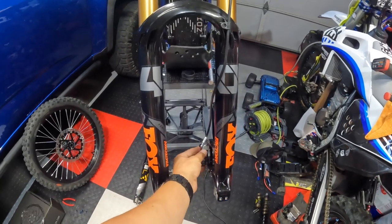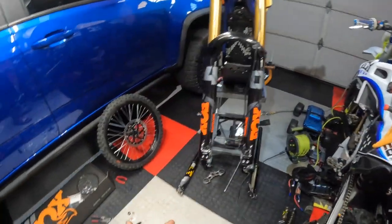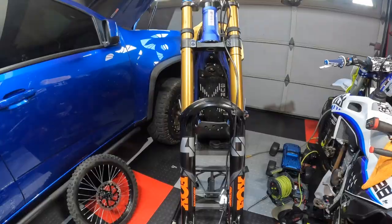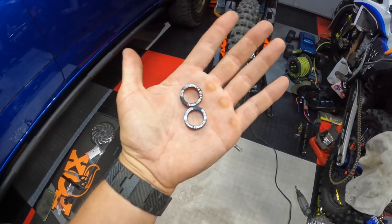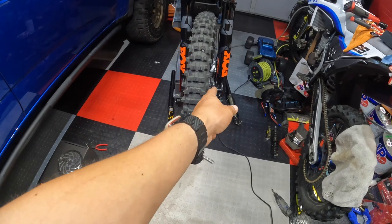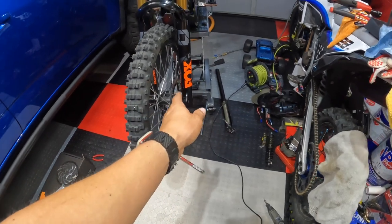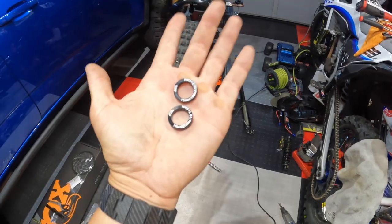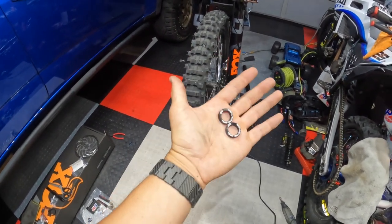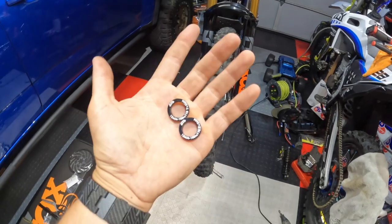Now the only thing left over here is to mount up that wheel, get the caliper centered on the disc, and tighten everything up. And then the front number plate — that's pretty much it. Also, one quick note: when you get this boost spacer kit to align the rotor with your caliper, you will only use the spacer and those long bolts. The other pieces in the kit are extras — you won't have to use those. This is like a mountain bike kit, so you don't necessarily need everything that comes in it.